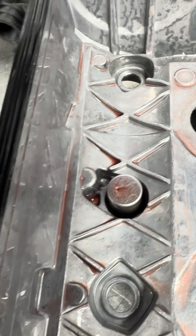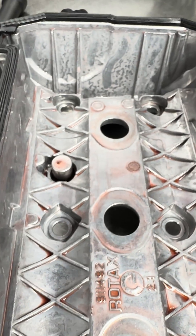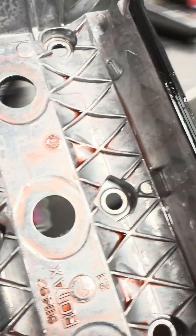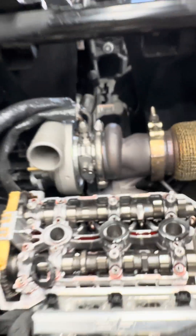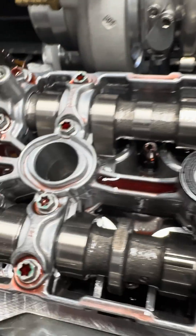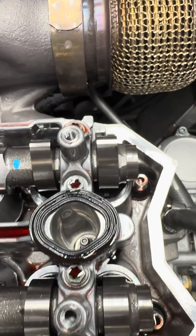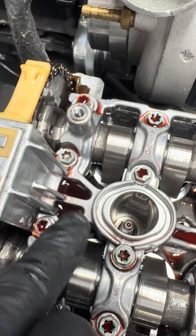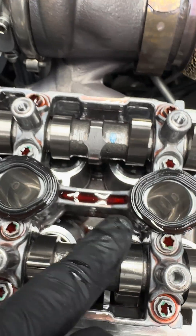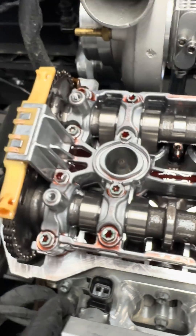The longer the car runs, the worse it gets. We'll show this in other areas where you're going to have milky oil — situations where you're constantly seeing water on the cam lobes and things. These all look super crispy, but you'll see water down here in all these little areas — just milky oil. Get in there and look; let's get you guys looking.